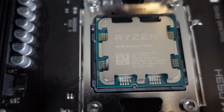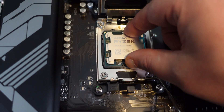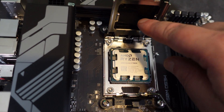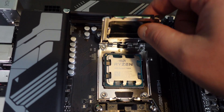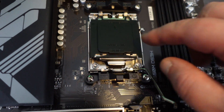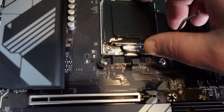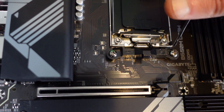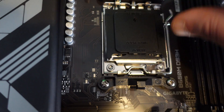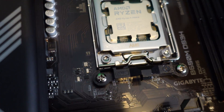You really have to mess things up to put this in backwards. Now that the CPU is in tight and in all the grooves, we need to lock it down. In the previous 3000 and 5000 series there was no plastic cap — that's an Intel thing. On this board you just push the lever down and that cap pops off on its own. We clamp it in, the cap pops off, and our CPU is now installed, nice and tight.